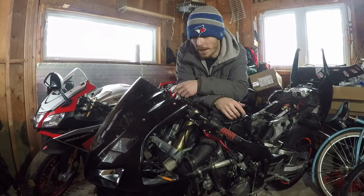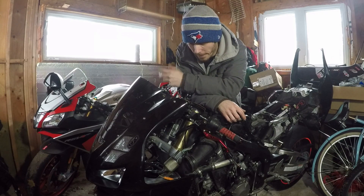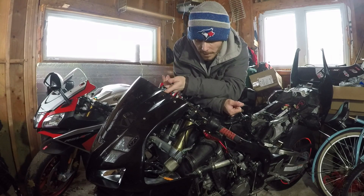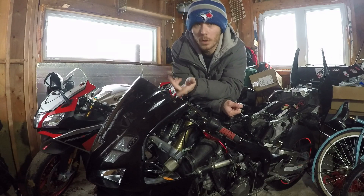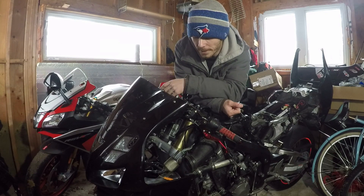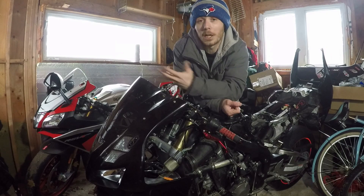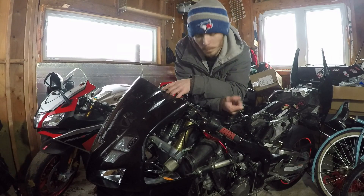Hopefully I was able to help you. That's how you test the bank angle sensor. Putting the nose back on is everything in reverse — it's more of a pain in the ass because you're trying to line it up and get the air ducts lined up and pushed in. But it's really simple. It's an easy test, there are only three wires. If you test the white wire with the black stripe and the green, that should be reading battery voltage. If you test the red wire with the white stripe — that's positive, and the green wire is negative — it should read zero volts. The arrow should be pointing up. A lot of people install it upside down, so that could be one of your issues. Maybe the previous owner installed it upside down, or maybe a wire came loose. Just take a look at it. Hopefully we've figured out your problem.